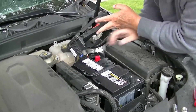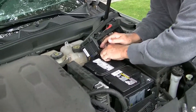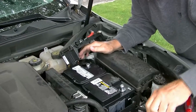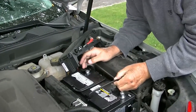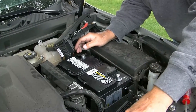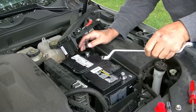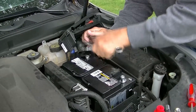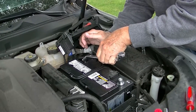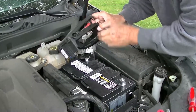Okay, so here we are putting a new battery in. Basically you just need a couple of wrenches. The hardest part was getting the old battery out — there are no handles on the old battery. So what you do is take a 19 millimeter socket with an offset, put it over the terminal like this, and lift it up, and the old battery will come out. Otherwise it's a pain in the butt. So here's the battery out.